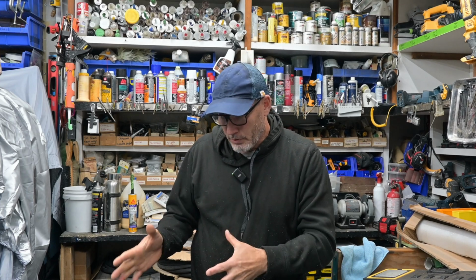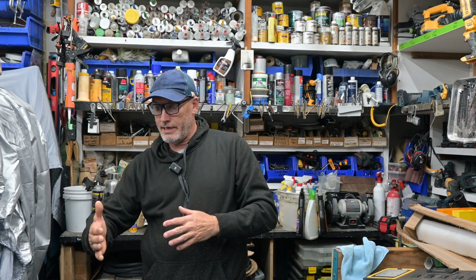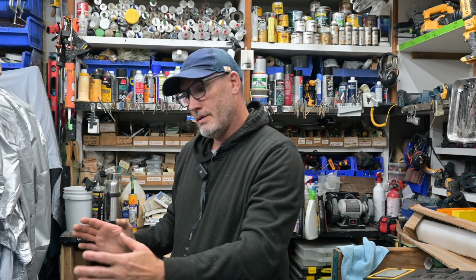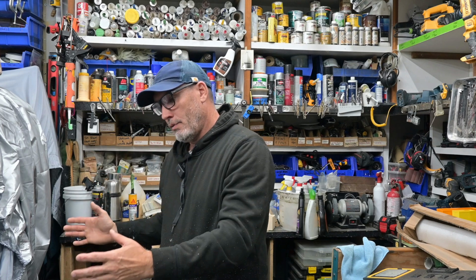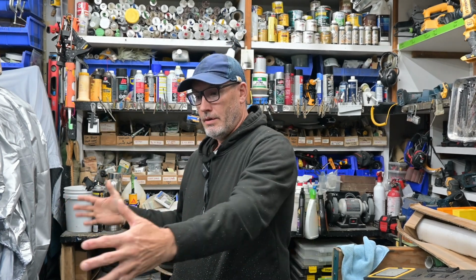So I put a lot of work into this one. I think there's enough straight edge of the trailer before it starts curving into the yoke that I've got another foot of adjustment, maybe 1.5 feet. But I'm going to combine that with turning it from a single axle into a double axle trailer. I've got some ideas, and by doing that it should shift the balance point and create a more stable, non-tongue heavy ride.